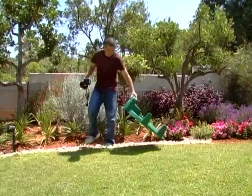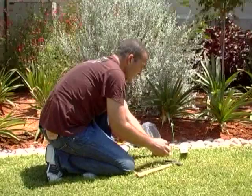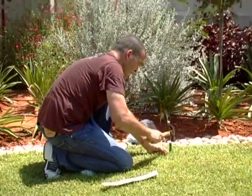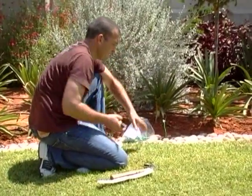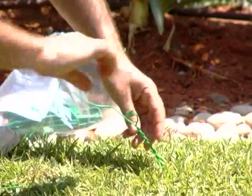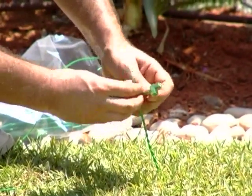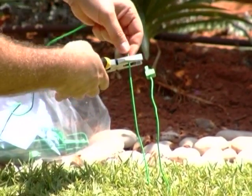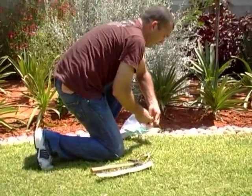The last step to complete is attaching the perimeter wire ends to the base station board and testing the setup. There are two loose wire ends where the perimeter wire setup was started. Use the same peg to fasten these two perimeter wire ends down to the ground and twist them. Cut the wire end without the connector so they are of equal length. Discard any excess wire. Strip back six millimeters of insulation from the wire end.